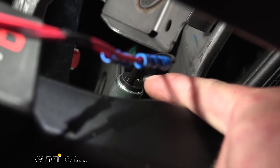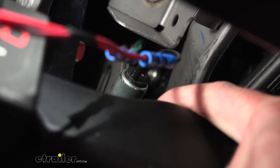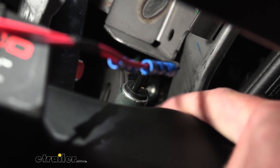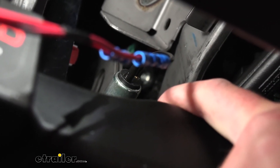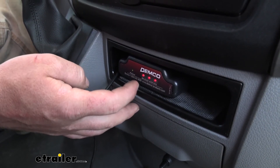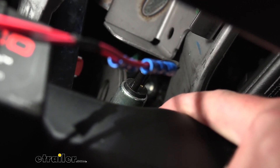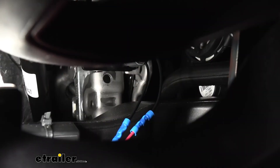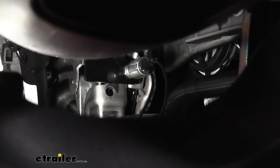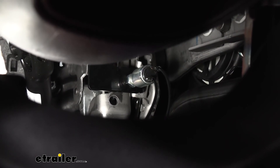The stoplight switch is a separate component you'll need to pick up separately — we carry these at eTrailer. The reason we need it is to pick up a brake light signal: whenever the brake pedal is pushed down by the braking system operating, it sends a signal out of the switch to the wireless transmitter, which sends that information to the monitor plugged in at the front of the motorhome. That's how we know our brake pedal is being depressed in the vehicle while flat towing. The stoplight switch bolts to a bracket set against the brake pedal arm so whenever the arm moves, it activates the switch.